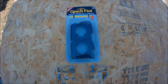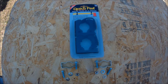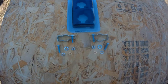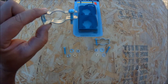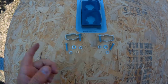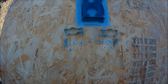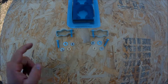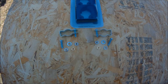These are the clamps that will hold my shovel, but we have to figure out a way to mount it to the roof rack itself. Down here is the mounting hardware — these are conduit hangers. You can get them anywhere that sells conduit, but I got these at Home Depot, along with some nuts, bolts, and lock washers. We're going to spray paint it black so it matches the roof rack.